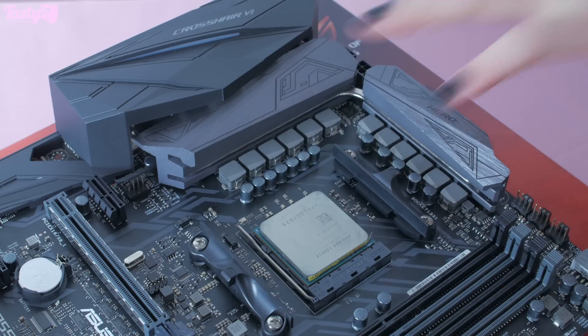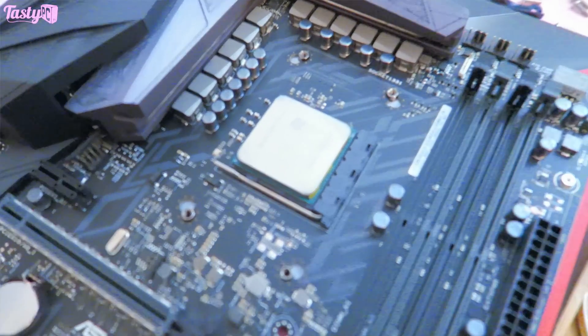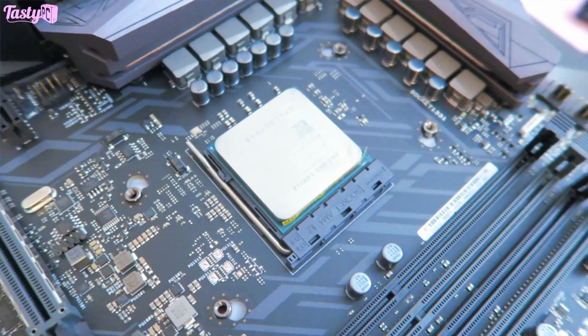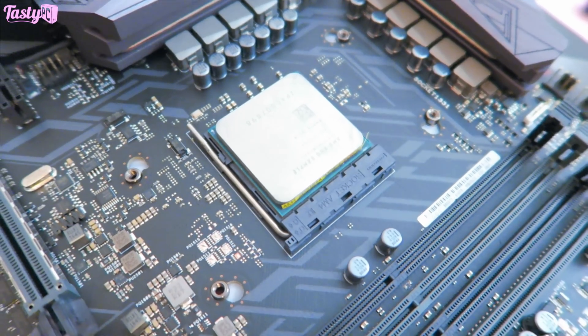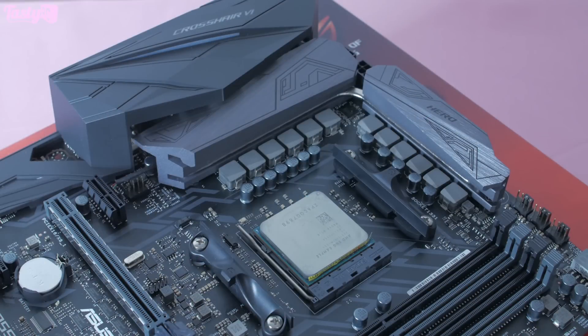When it comes to cooling, Asus have actually added additional mounting holes for AM3 coolers, and this should allow you to continue to use your older AM3 coolers, water blocks, and LN2 pots. Although they don't actually provide you with an AM3 backplate to be able to do this, so you have to harvest one from an existing AMD board. I tested my NH-D15, and it did leave a really nice spread with the thermal paste when I took it back off, so I think it made good contact there.